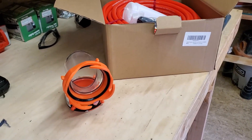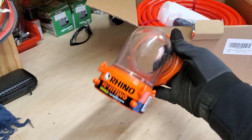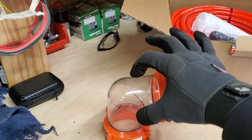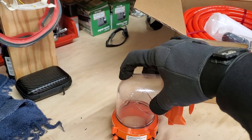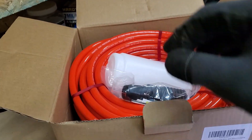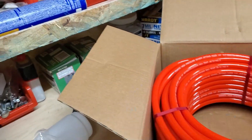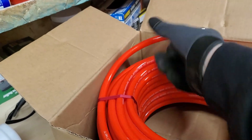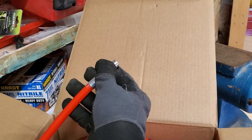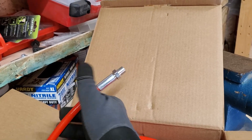We're going to go into the parts we're going to need for this task. For starters, we've got a 90-degree elbow that we picked up at a local RV store. We're going to have to drill a hole in the top of the elbow on the backside so we can feed the hose through it. We also have a kit ordered off Amazon — it's got a bunch of different nozzles and tips. The largest fitting on the end of the hose is what we're basing the hole size on so it can pass through freely.